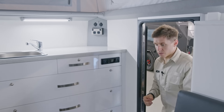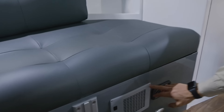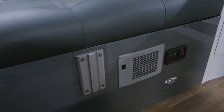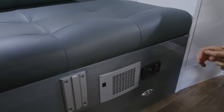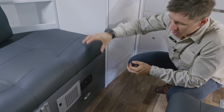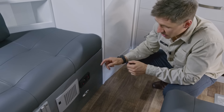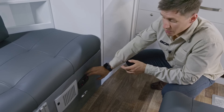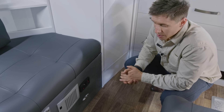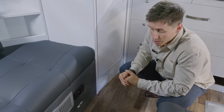Down here on the front fascia of the seat module, you'll see a grille outlet and a little controller to the side. This particular customer has gone with a diesel combination hot water system. What I mean by combination is we've taken out the diesel cabin heater and the gas hot water system. This hot water system now has the ability of a heater built off it, with the outlet just here. With this little controller, we can control the temperature and fan speed. These are quite new in our world, but they are good little features. For some people who've come from a diesel background, these are things that we're now incorporating and can be done in Quantums for people that want it.